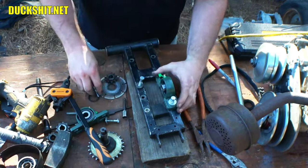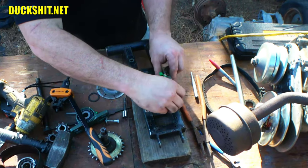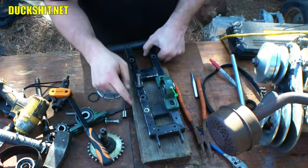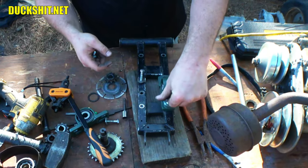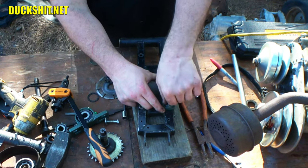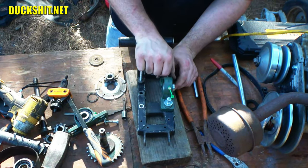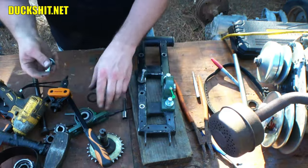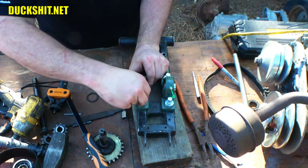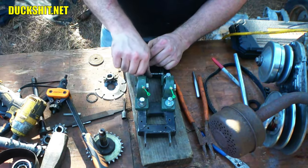We can get this bolt put in. This bolt put in. You know, I'm doing it backwards. Don't do it backwards. Okay, this has to go this way. Because as I said, the grease zerks need to face the rear, and this smaller section back here is where the rear end is at. So, should I ever have to grease these things, it's going to be nice to have them pointing in the correct direction so they're easy to get to. Thinking ahead about this stuff, guys. I mean, it really doesn't matter which way you put them, but if you're caring about future upgrades or repairs, this stuff actually might be kind of important to you.